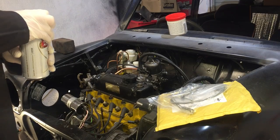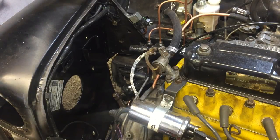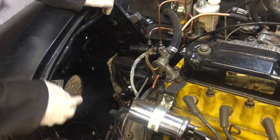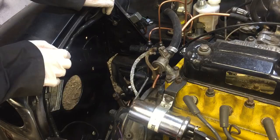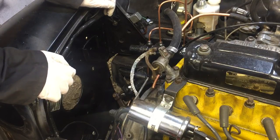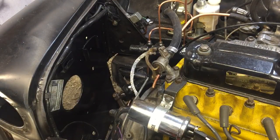One of the first things we've got to do is tighten up the brake unions, which in hindsight I should have done before putting the engine in. I've had one more attempt at trying to get to these, and if I can't do it I'm going to try and get a jack under the engine and see if we can just lift the engine a bit by undoing the subframe mounts, which are just held in by pins — quick release ones. Let's get these tightened up and then check the back unions are all tight before we start thinking about bleeding and filling with fluid.